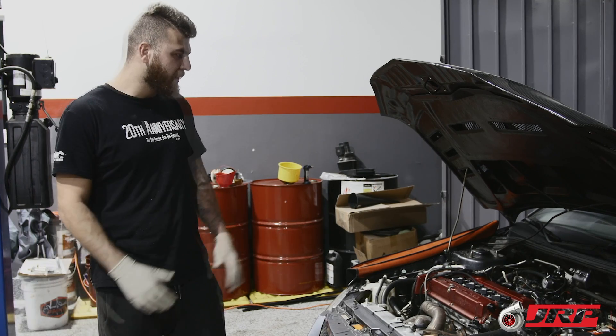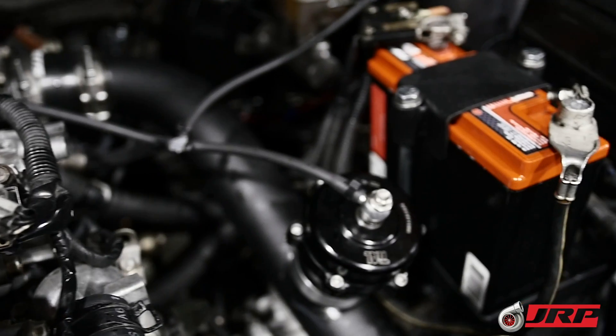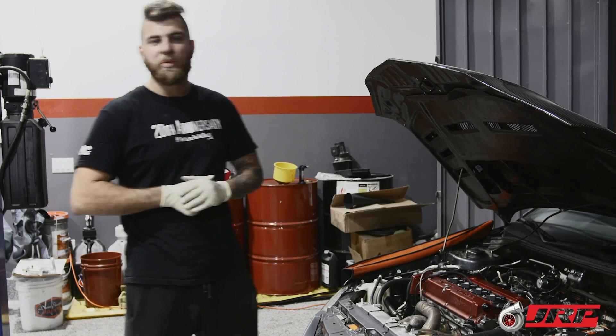He has a three-and-a-half inch ETS front-mount intercooler with standard two-and-a-half inch ETS short-route piping, with a mini-battery top-mount BOV. Obviously this car is on speed density.